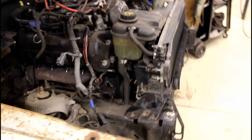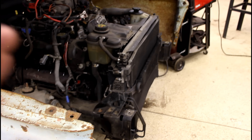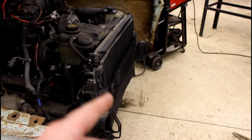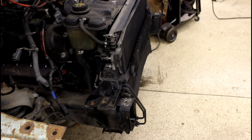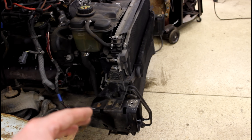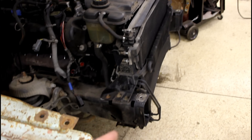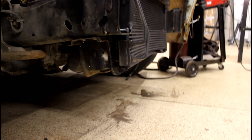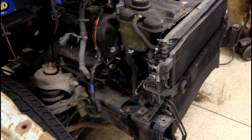To move the radiator back, it doesn't get much simpler than this. It's a pretty easy setup. The way that the Crown Vic radiator originally sits, it kind of sits at an angle and kicks out a little bit. What I did was — I've already cut off the frame extension there — I undid these three bolts on either side, and then undid the cross member cradle that the radiator sits in, removed that, and it's just as simple as pushing it backward. I pushed it back two inches.